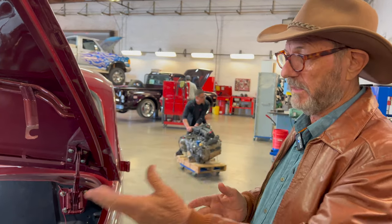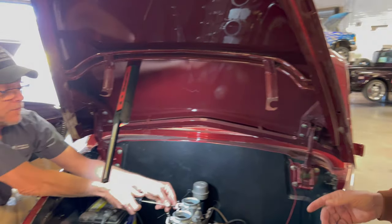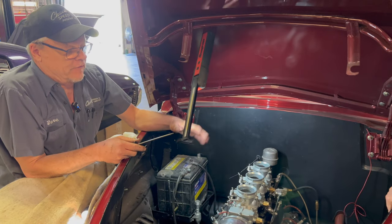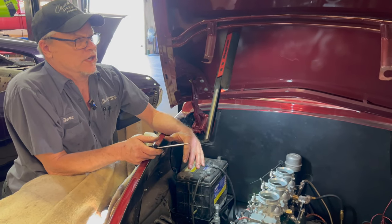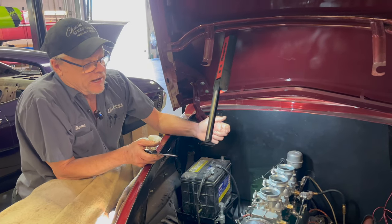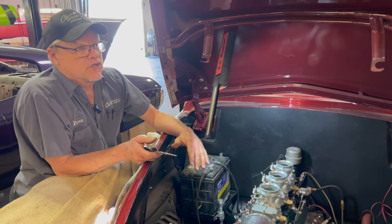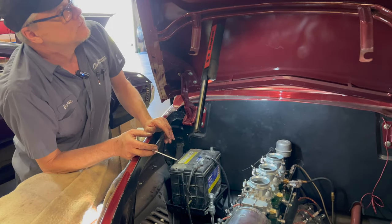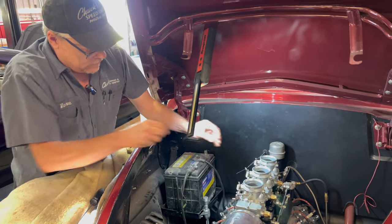If I can distill it down, I think what he said, at the end of the day, is that a single choke on a single carburetor, pick the right one, because it has less pieces and less chance of misbehaving. Am I correct in saying that you'd be better off just having one of these on a choke, maybe the center one? You can have one. If you have three, it's three times as much fuel you're putting in when it's cold. Got to be mindful of that. So then you're finding that you're pushing your mechanical choke back in and not using it quite as long. Less length of time if you're using all three. So it really doesn't matter, either way, you just have to be mindful of what you're doing.